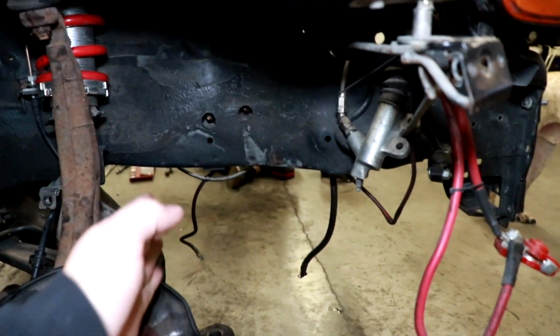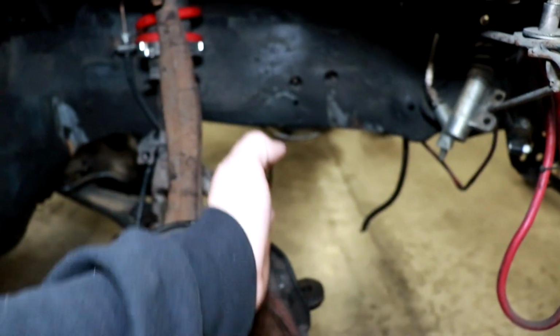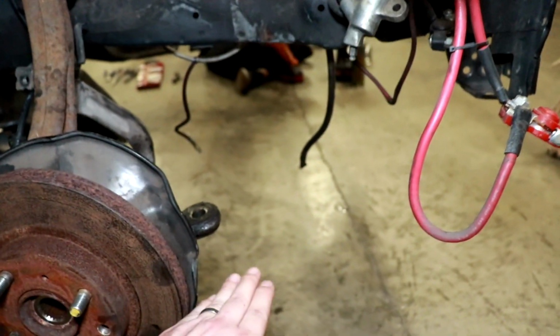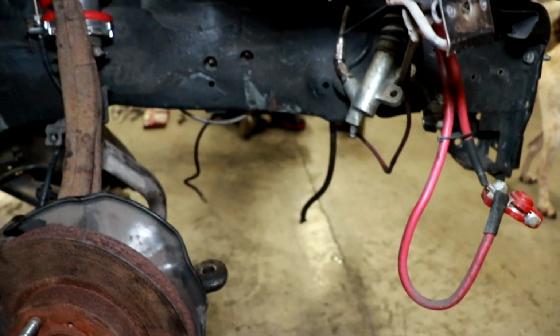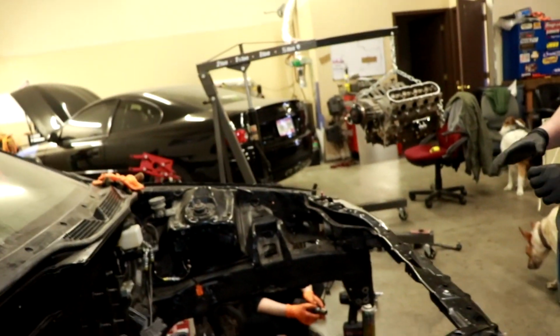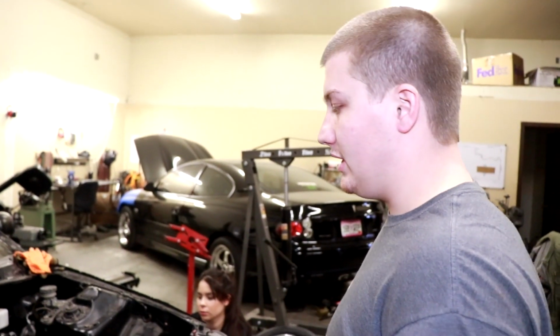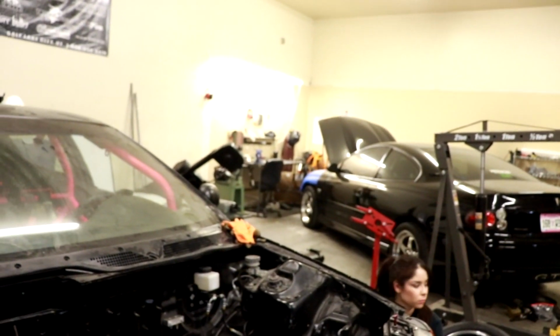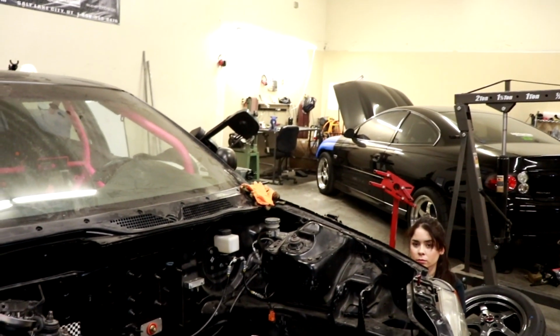We're just gonna have a steering rack that's gonna go somewhere around this area, and it's gonna attach to both of those original points. We may have to drop it down a little bit, but it still will attach to the original points. So we'll feel pretty safe about that. It'll be a lot safer than trying to weld anything to it or make anything like a bolt off the caliper brackets or anything else. It seems more proper. And it's amazing that those things switch back and forth.